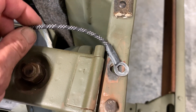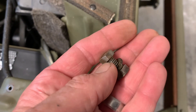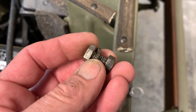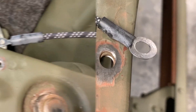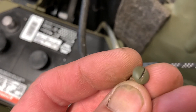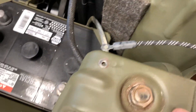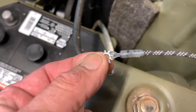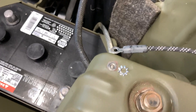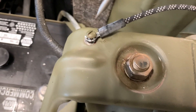There are two round connector eyelets on the ends — the larger one is going to go to the front, connected by a 5/16 by half-inch bolt with lock washer and nut. The other side is going to be connected where I removed the screw, and that also is going to need an internal washer. Here's the original screw — I'm going to clean the rust off before I install it. I've also got a brand new internal-external star washer that fits that screw perfectly to give a good bite on the metal and make a good ground.